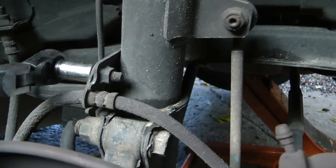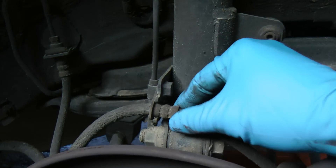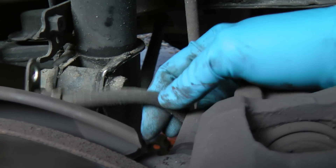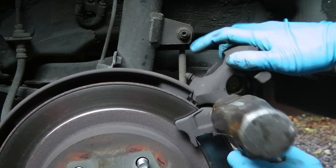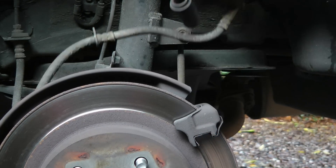It's time for the big hammer. But first we're going to remove this bolt so we can get more room to slide the hose back and forth. Now we can get the hose out of the way so the whole caliper assembly won't get stuck on the hose. Then it's time to start whacking — the pin is stuck on this side so we'll hit this side, and you can see it's starting to move, and then off it comes.